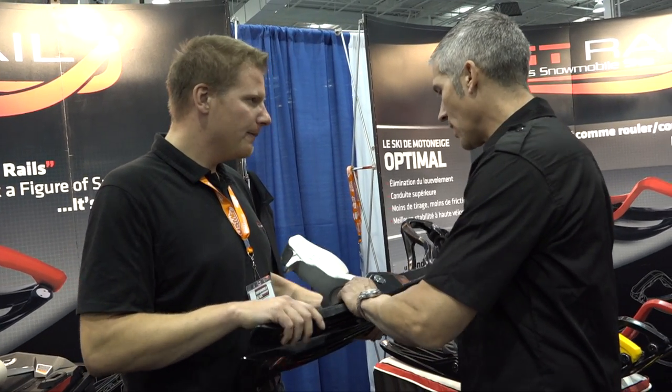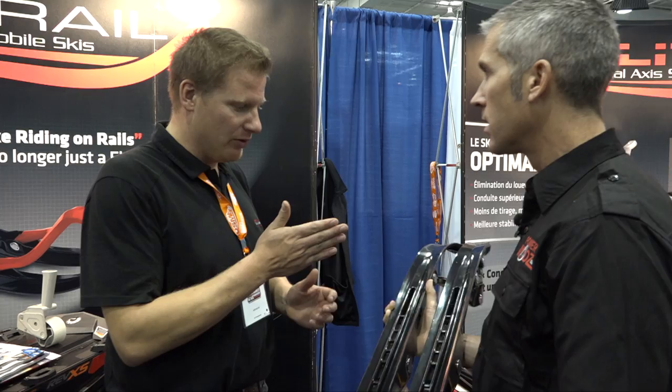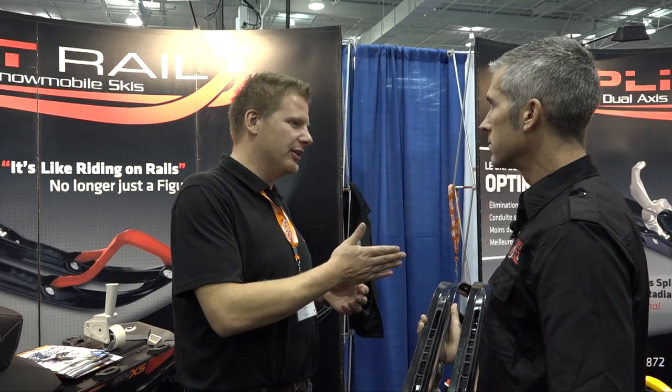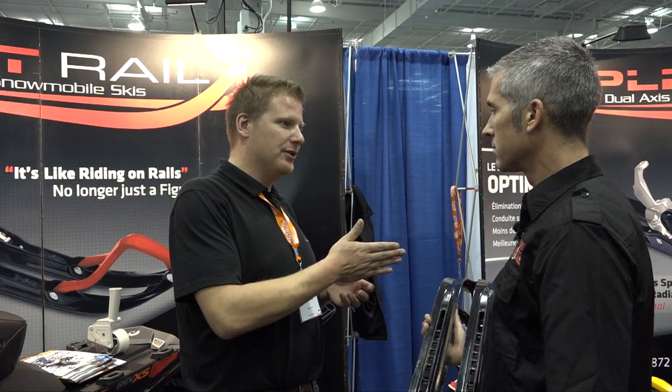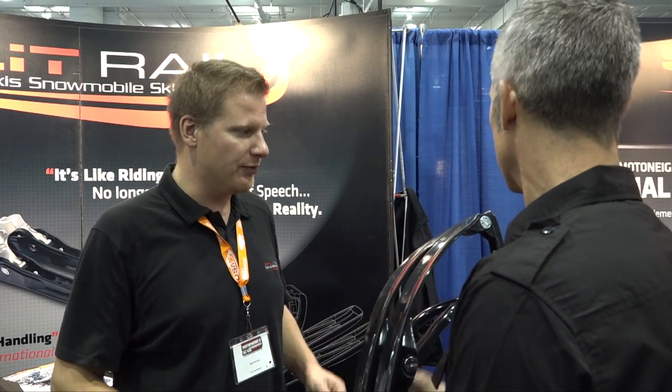I can see how, when you're riding with no deep keel, a lot of times you come out in the morning, somebody's gone through there, left a big keel mark in the snow, it's hardened up, and you grab it — it just sort of train-tracks or rails you. Exactly. So that keel, when you have a keel on a ski, it acts like a knife edge. As you drive straight, it causes drag, which pulls the ski down in the snow further. When that happens, the keel is going to find the least resistance through the snow — it's looking for softer, low spots — the harder pack it'll try to avoid, and eventually it hooks onto someone else's track and you start darting as it follows it.